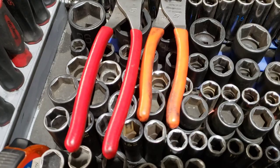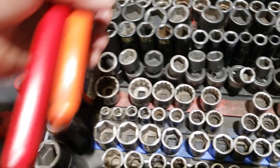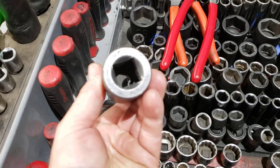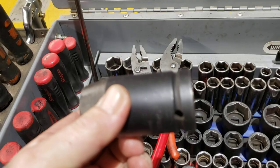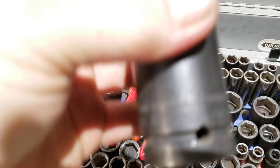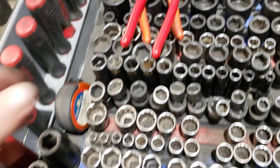This is most of the sockets I own — I have another socket drawer in my toolbox but for the most part this is it. Now these guys — you ever have a balancer that just won't break loose? Honda and Toyota sell tools to hold the balancer, but if you just want a little extra oomph, get these. This one's three-quarter drive for Hondas, and this 22-millimeter is for Toyotas — also three-quarter drive. I just use a half-to-three-quarter adapter, and that will take off most Honda and Toyota balancers even if they're really stuck.